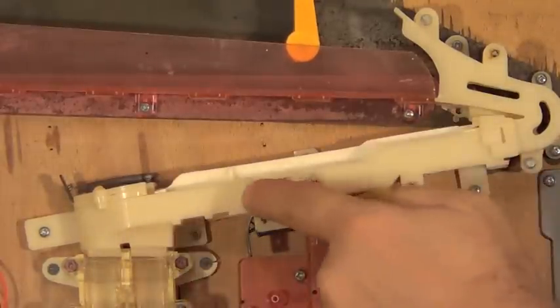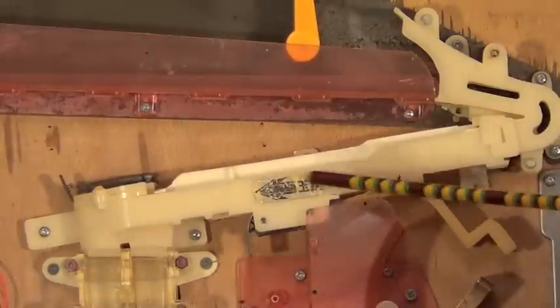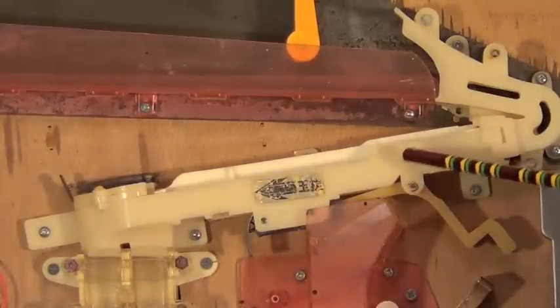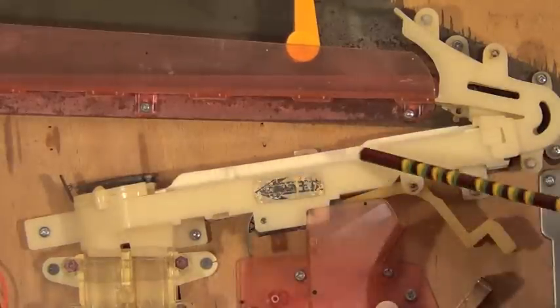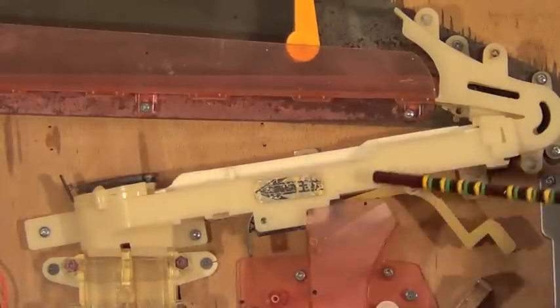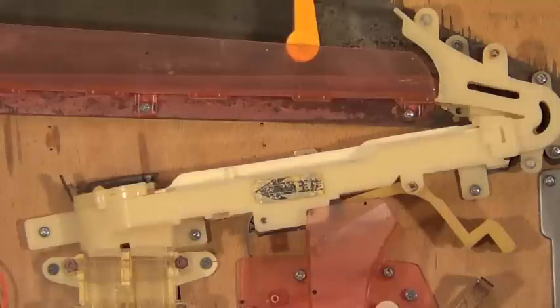On this lower track there is a piece of plastic — it's a lower track cover. A lot of times they're missing. If yours is missing, you can cut a piece of cardboard or plexiglass and tape it in there or somehow secure it. Basically you have to have something there, otherwise balls won't enter the jackpot assembly properly.